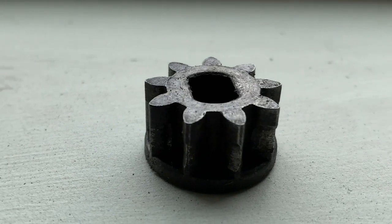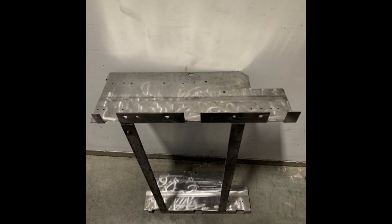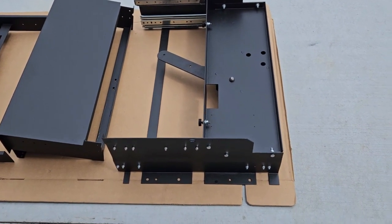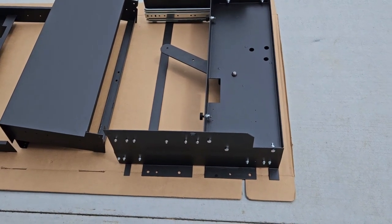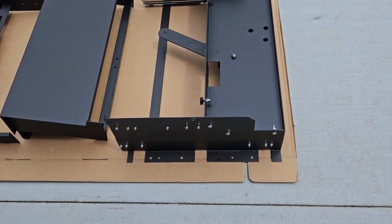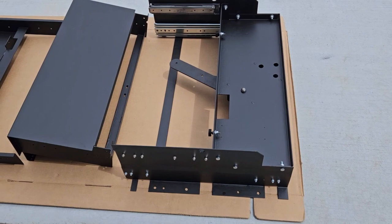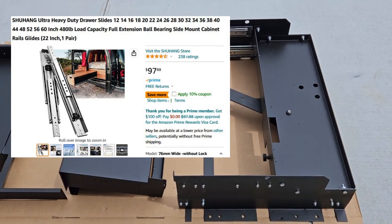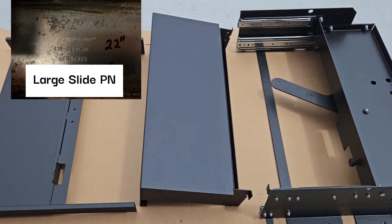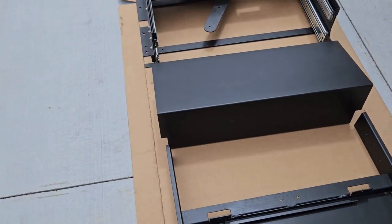You can get it online from AM Products — they're in Oregon. $8.93 plus $15 shipping, so if you ever need one of these, they're relatively easy to replace. The entry steps have been cleaned up, taking all the corrosion off. We protected them with Eastwood rust encapsulator paint — I actually ground all the rust back. Used a grinder with grinding pads, wire brushes, and then paint. This one's got new large slides — the smaller slides were okay. Cleaned up and repainted.